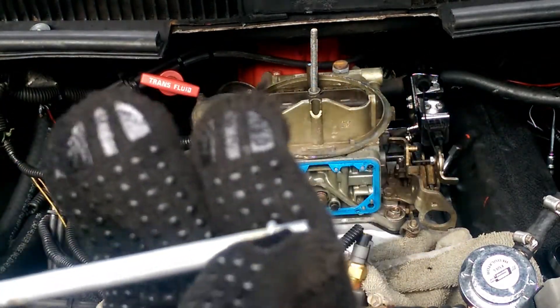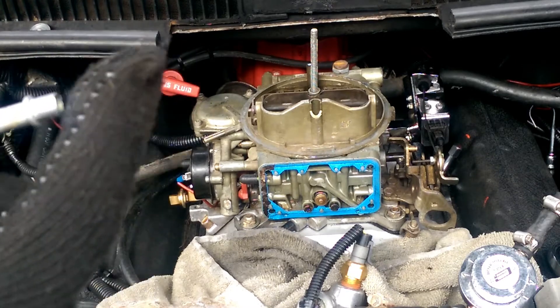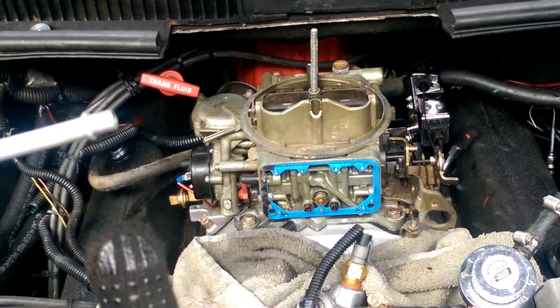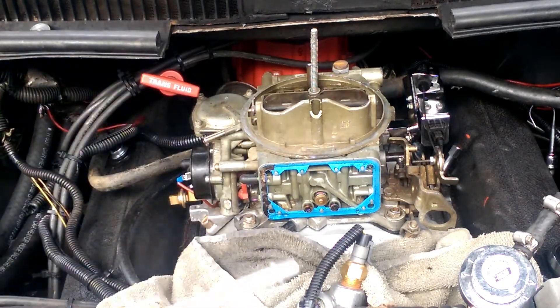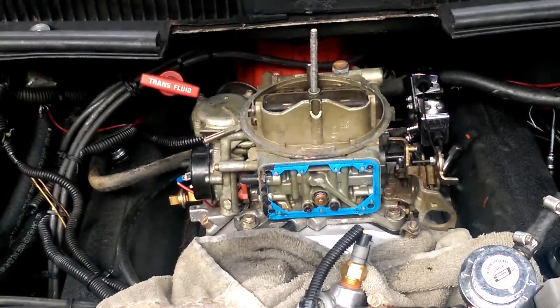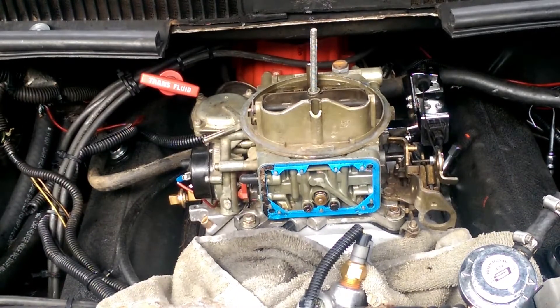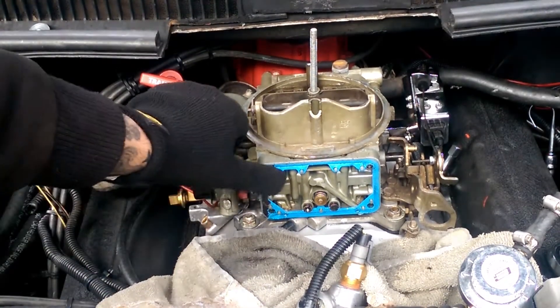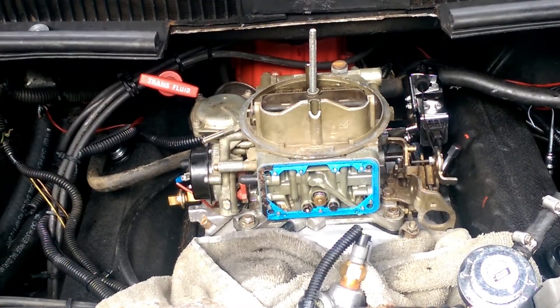Now you've got a little O-ring. You need to fish it out of that carburetor right there because you don't want to mash it in or clip the O-ring — then you'll have a fuel leak. Take the O-ring out and put it back on when you install your bowl. Here's your float assembly and stuff. You can see our gasket tore a little bit — I should have an extra gasket. A gasket you could probably reuse but we're not going to.